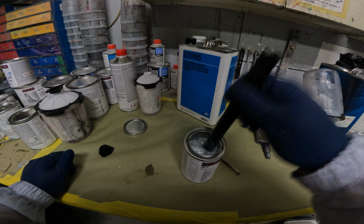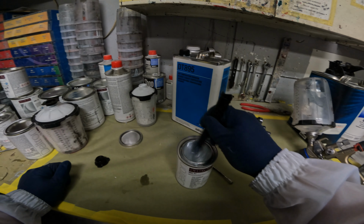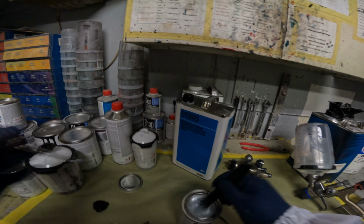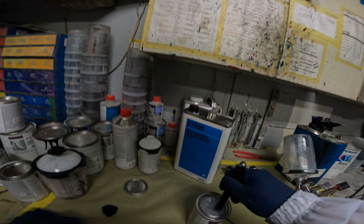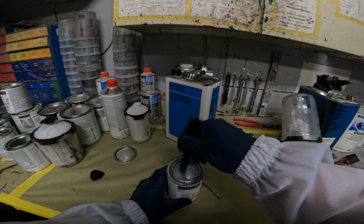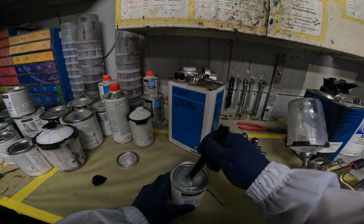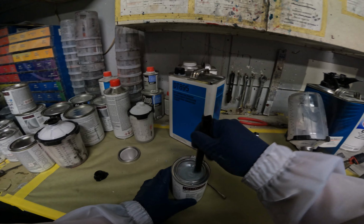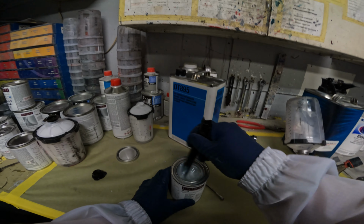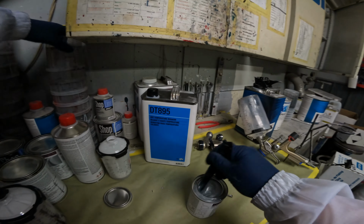It's almost like a pretty thin layer, I'd have to say. But nonetheless, no amount of pearl is gonna cover a bad color. I'm just telling you that right now. Yes, it will darken and lighten the color, depending on what kind of color it is. But most tri-stages, you're not gonna get much of a difference in the color with that second layer on. So it's very, very important that everything looks good on your ground coat first.